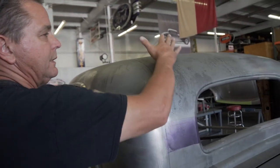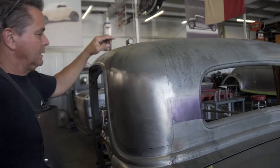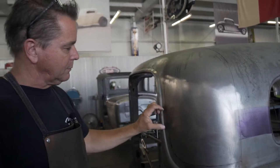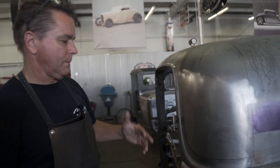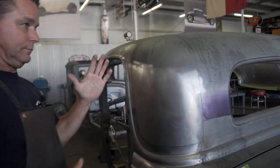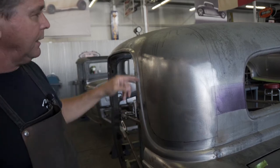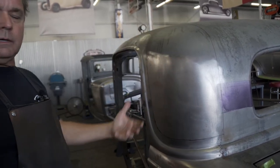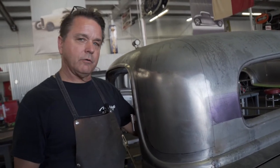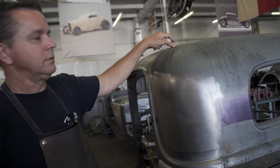Once this is leaned forward a little bit, and all this is down, and everything's back, and it's tack welded together back here, and this seam here is finished, and this is real easy to finish because we're only dealing with this little bitty area, then you take this piece and you slide it up in here, and you can position it where it's perfect. Then you just put one scribe line on it and trim it all the way around it and put it in, and it works great. This really works good on '34 five-windows, especially this technique on '35 and '36 three-windows and five-windows.